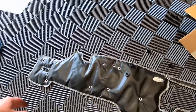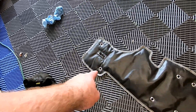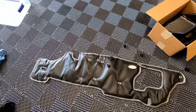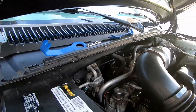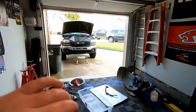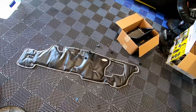There are nine holes or clasps — don't count the one on top, that one doesn't take any hardware. We only have five of these pins, so four of the holes are going to use a bolt taken off the firewall and put back on. The only one I didn't find was on the bottom underneath the AC canister. Everything else pretty much lined up. There's no more firewall blanket on the truck at all — we're basically going to fish this new firewall blanket back over and behind the motor, then figure out which bolts have to come out.